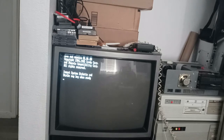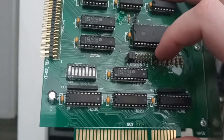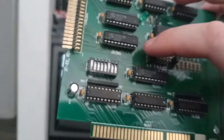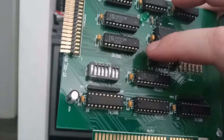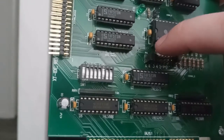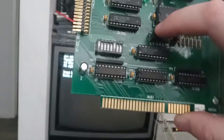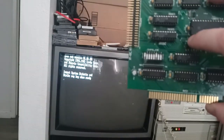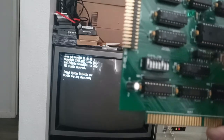So I'm going to go look the jumpers up on this, and then we're going to figure out what's going on. Okay, so I've been looking at it on -0degrees.net. This one does cable select low-high selection. The very first one here enables and disables the BIOS ROM, so we're going to disable it and boot off that floppy disk. And then the second one disables or enables reading and writing to the ROM. Right now it's enabled. I don't think my dip switch settings for memory are bad though. So we're going to just pull that first jumper right here, and we're going to do that.